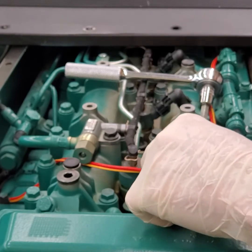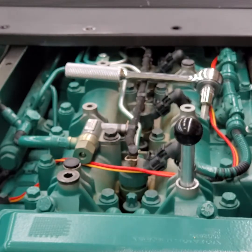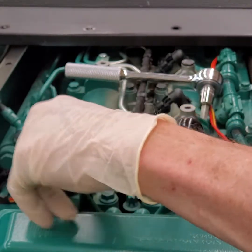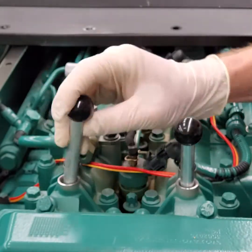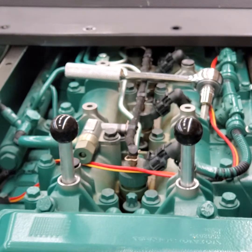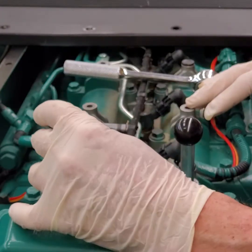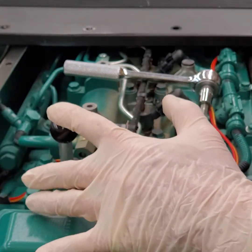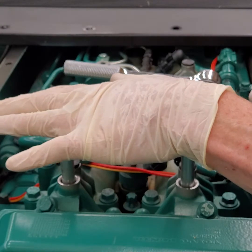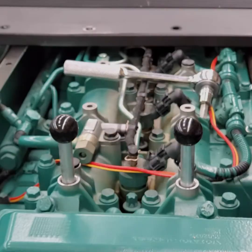That's factory torque. This is where the two cam pins go — pins 885493 — and they fit into both camshafts. You have to lock the camshafts in place as well as the crankshaft if you're going to change the high pressure pump. What I typically do is bar the engine over first until one of these pins starts to drop in, then wiggle the other pin, then rock it back and forth until I get both pins in. Once they're in, you can put the crankshaft pin in. The crankshaft pin is on the back side of the engine — on the flywheel, starboard side if you're facing forward on a standard stern drive inboard.